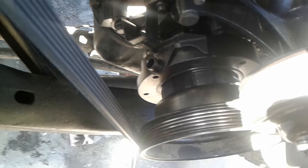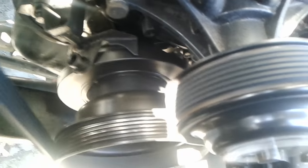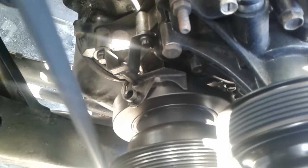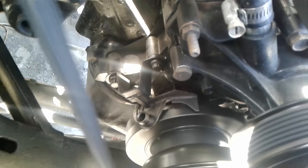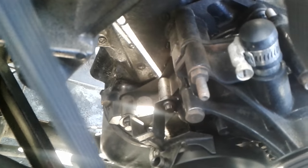Okay, look at all that wobble in there. I don't know if it's a bad crank or bad pulley — you can hear the squeak coming in now. Look how bad that pulley is moving around. I'm looking at the crank too, but the harmonic balancer belt doesn't seem as bad.